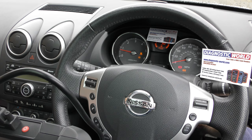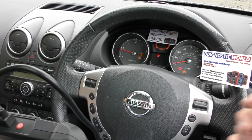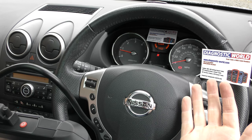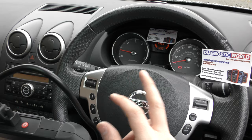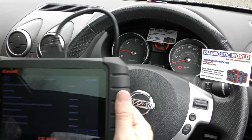So if we just turn the engine off and then turn it back on, that'll do a quick reset. Sometimes the warning lights will turn off when you erase the codes; sometimes they do need a quick engine restart — which is exactly how it's worked here. Everything has gone off now.